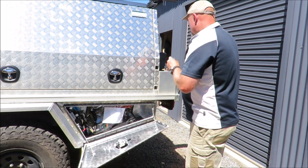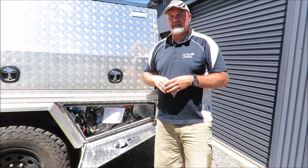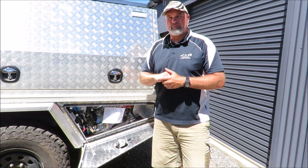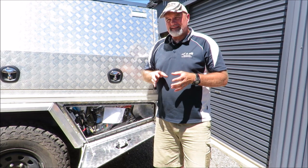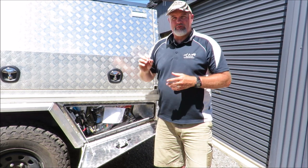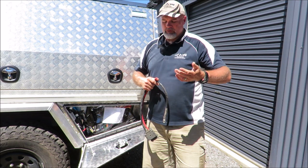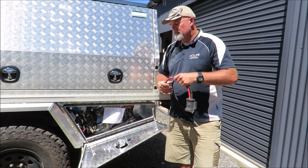Make sure you get your fusing right — use a fuse, and get the size right. The second critical thing is cable size. On Facebook groups people often ask how big a cable to run to their compressor. It really depends on how long the run is and how many amps your compressor uses. The ARB is around 23 amps. I originally put in a Thumper Max which pulls about 90 amps, so I calculated and ended up running 2 AWG — which is really thick cable — because I was pulling close to 100 amps over about six meters.